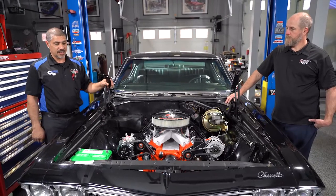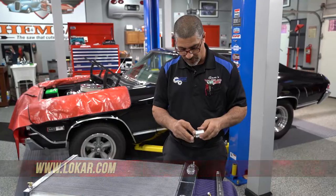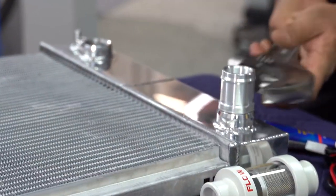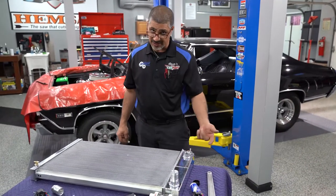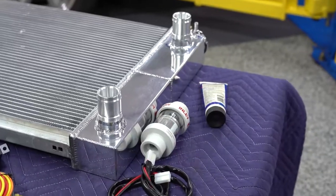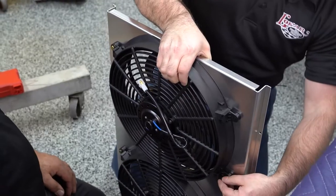We're going to show you guys how to install all these parts. I like to use a 160, no more than a 175 thermostat on an engine swap, just to keep heat down in the engine bay. This radiator comes with screw-in bungs that have an O-ring. You don't have to use Teflon tape on this, but you do want to lube that O-ring so it doesn't bind when you screw it in. Just snug it — if you go too tight, you'll bind it into the threads and it will never come out. There's also a steam vent; it comes with a plug if you don't have an LS engine, but if you do, you need to use the fitting and don't forget Teflon tape. The kit also comes with a filter that catches debris from manufacturing and helps you monitor coolant condition.